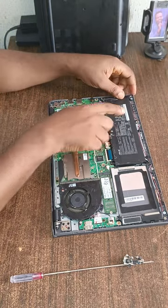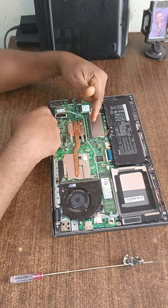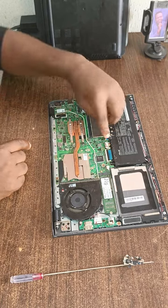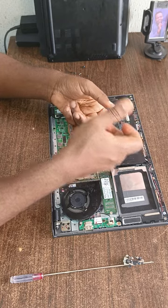You can see — that's the battery, and this is where the hard drive and the SSD are. Okay, and that's the RAM. So let's pull out the battery. All you need to do is slide back the steel slider and pull it up with your two hands.